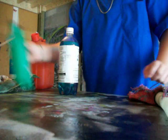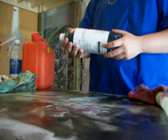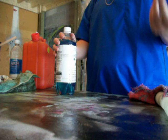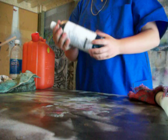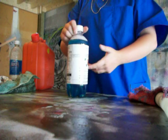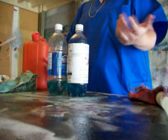Might be different for your bike, but that's how you mix 40-to-1 ratio. For lesser ratios, like 32, 30, 25, you just put more oil, like 30 milliliters of oil per 1 liter. So that's what it should look like. Kind of looks like Kool-Aid. So yeah, that's how you do it.